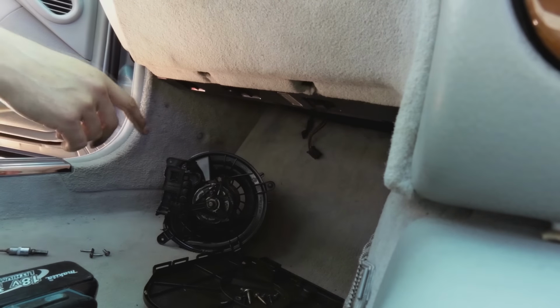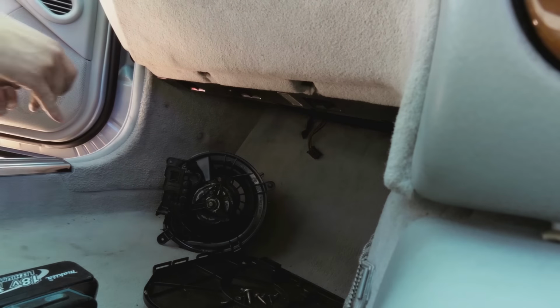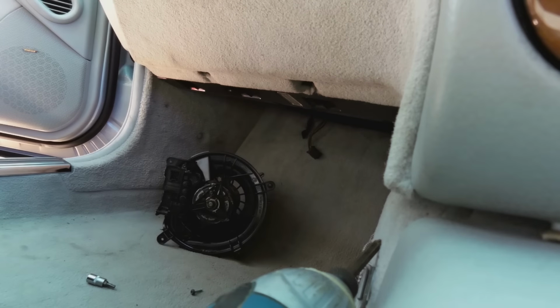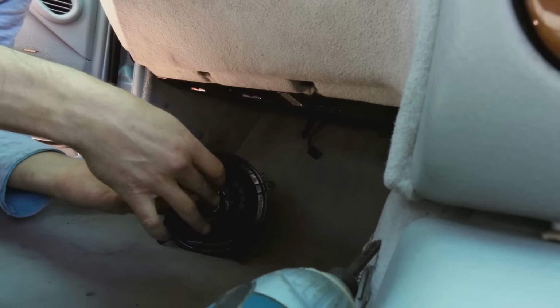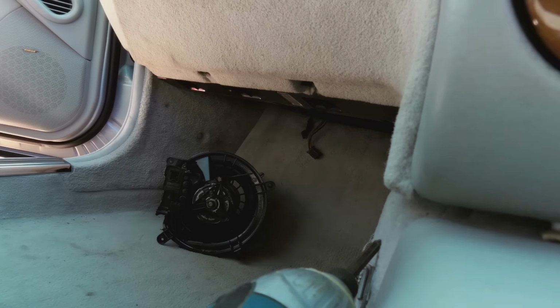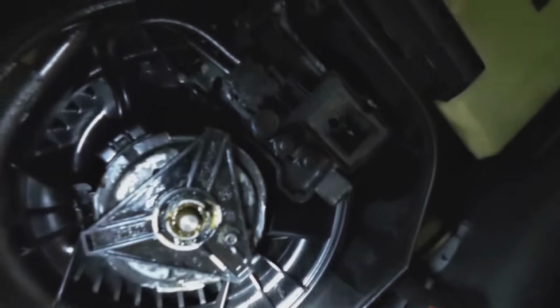All right, so what I'm going to do now is I'm going to install the blower, but I'm going to get upside down. I'm going to be in the way of the camera almost the whole time. So screw there, screw there, screw there, there. Then you need to just plug it back in over there with this guy over there. While I'm here, I'm showing you, there's the carbon block filter, 1 and 2. You unclip that, you slide it, put the carbon block in there.